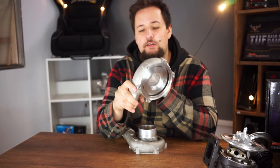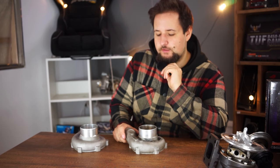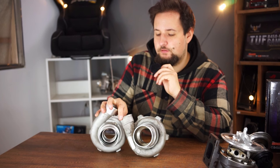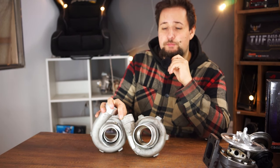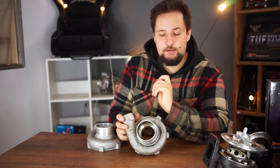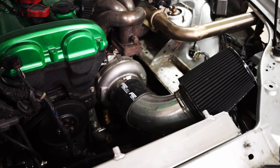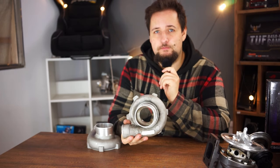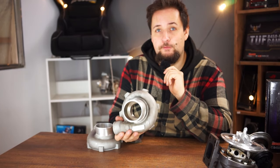A different thing: when you are not running a blow-off valve and you want to make your flutter louder, you can use a compressor cover that has no high-flow options. As you can see, the one on my right side has high flow and the one on the left side does not — the turbo flutter is going to be way louder when you don't use a high-flow housing. Also, when you put on your intake pipe that is at least 30 centimeters or so before your filter, that also makes the flutter way louder because it reflects inside the pipe. A setup with a pipe in front and then the filter — instead of putting the filter directly on the housing — will also increase the flutter significantly.